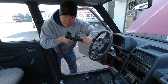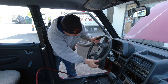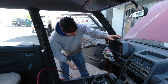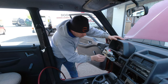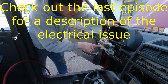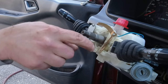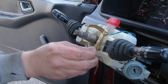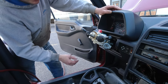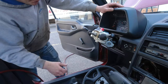We are pulling off the steering wheel in preparation for removing the steering column — probably I'll need a puller but not necessarily. This is the horn contact and it wasn't tucked in the way it was supposed to be. That might be part of the issue with the horn not working — see how this can pivot back and forth? It's supposed to be tucked into that little pocket so perhaps it wasn't even hitting the metal ring behind there, which is enough to make the horn not work. We'll correct that immediately.